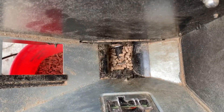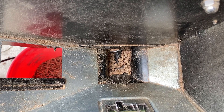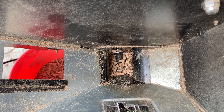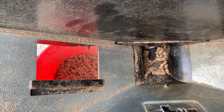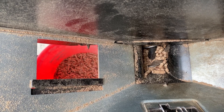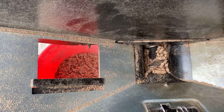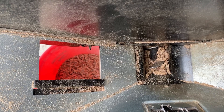I emptied all of the pellets down into the bucket and cleared out the auger pretty good. Poking around with my screwdriver I don't see anything that's jammed, so I'm going to start it back up on its restart procedure and see if the auger turns. I redid the startup procedure and everything seems to be going typically — the auger moved maybe about a quarter of a turn and now it's not moving. We start to have some smoke, some fire in the firebox.